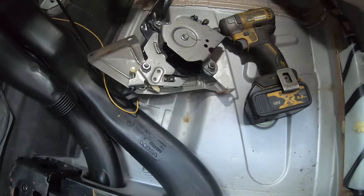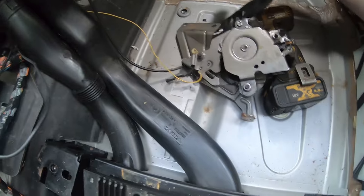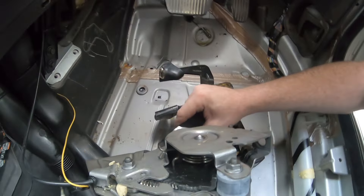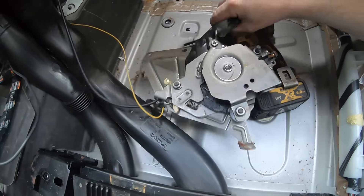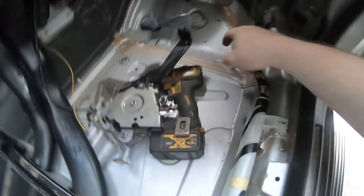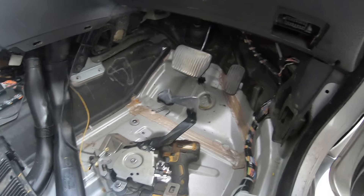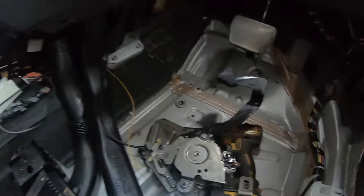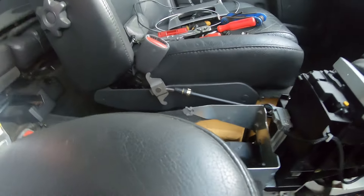This is interesting - I couldn't pull the cable out and it just came out. I don't think the cable has actually snapped - I think it just came off the lever. Yeah, I think it just came unhooked. No damage. Looks like I don't need to replace this cable after all - just reassembly. I'll prove it: if I pull on the end of the cable you can see the cable is moving. If I get hold of that end and pull - nothing wrong with the cable at all.